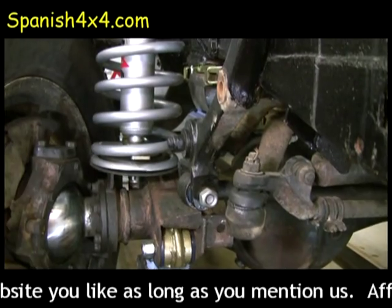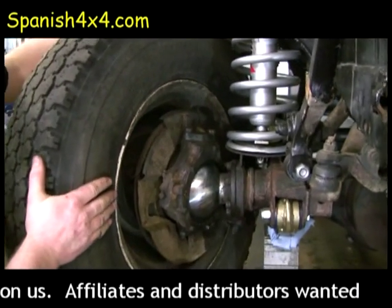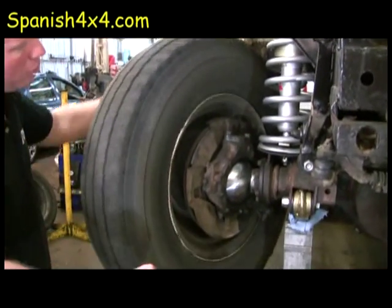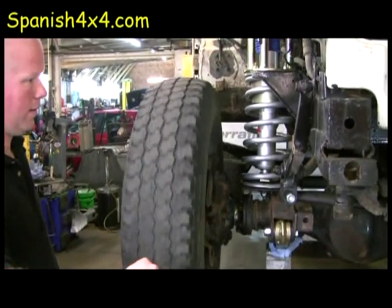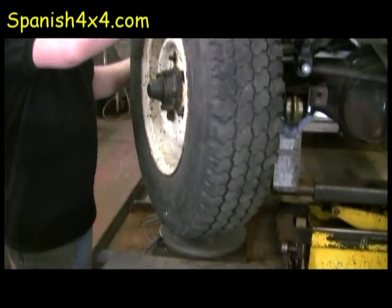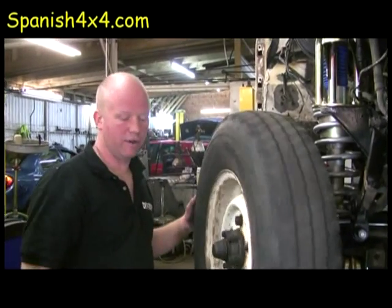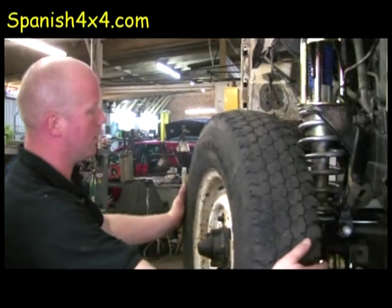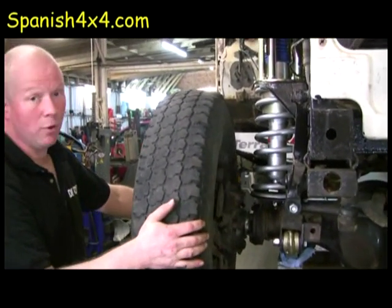The calipers are missing on this, you'll notice, because we're still filming another part of the DVD. So on full lock — part of the steering — make sure the tyres don't touch anything. Full left lock please mate. With a power steering model, all the power steering checks are done with the engine running. Turn the wheel straight.